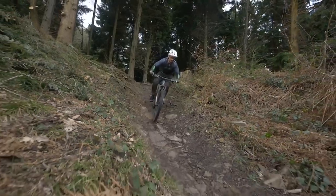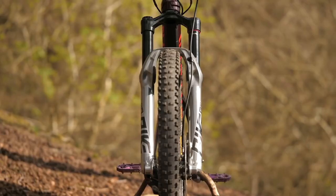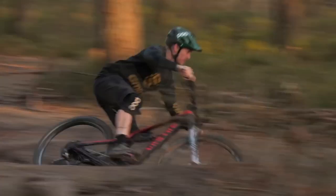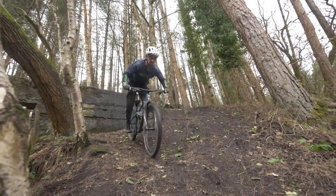A mountain bike is a strange thing because you could have a downhill bike that you're absolutely smashing in the park, but spending a lot of time in the lift queue, versus a trail bike riding at slower speeds but constantly working. I would try and estimate your hours — say if you ride five hours a week, you can work out roughly the amount per year. If something goes internally bad in the damper, it becomes quite apparent quickly. You can preempt the need for a service and avoid issues, because nothing's worse than something failing halfway through a holiday — and it'll probably cost a lot more if something goes badly wrong. So lower legs, definitely — it's a really good thing to do. An air leg service is also relatively simple and we've done it on the channel. The damper seal is more of a send-away job, but those two other jobs can really keep on top of a lot of the maintenance the forks require.